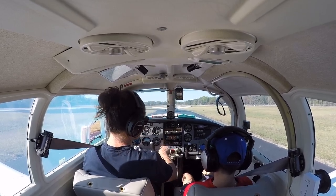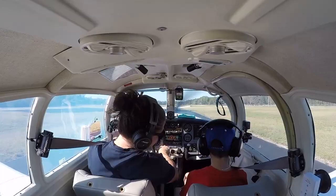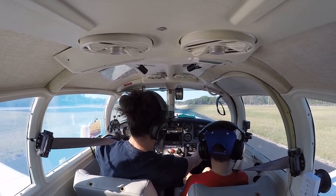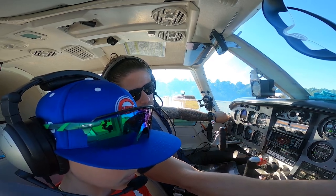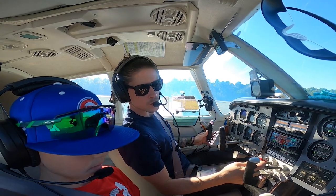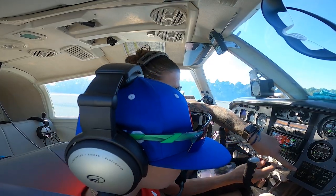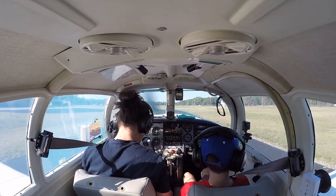Full rich, on the brakes. We're going to bring this up to 1700 RPM — looking down here for 17. There it is. Look at everything. Everything's holding. We're good. Suction's good. We're going to go two left and watch for a drop. There's a drop. Two right — should come back. One left. One right. There you go. Now come test the prop. Watch for RPM. There's one. Now we're looking for manifold pressure. It moved. Two. Now we're looking for oil pressure.